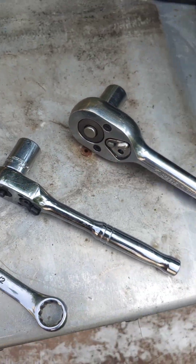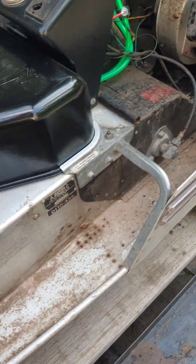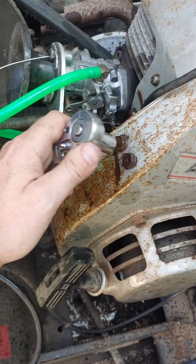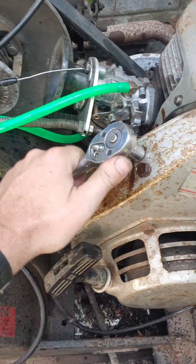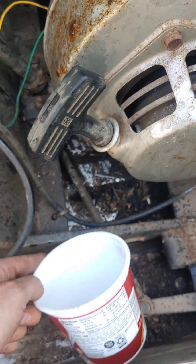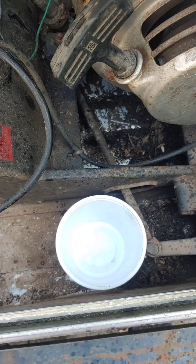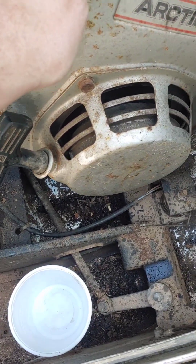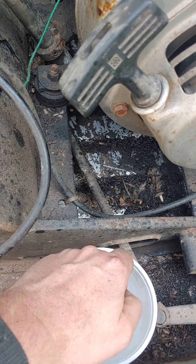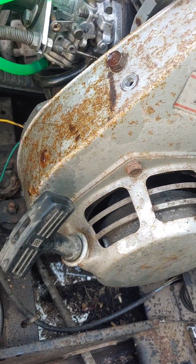That penetrating oil has been soaking in for about five minutes. Now I'm going to grab my half inch ratchet and start breaking these loose — and sometimes they go pretty easy. This is the way you want a project to go. When you've got your bolts ready to pull out, go ahead and grab yourself some sort of container, throw it down on the belly pan, and drop all the bolts in there. I can't tell you how many times I've found an oatmeal bowl full of bolts and washers and screws under a tunnel. Do yourself a favor and throw them in a container right away.